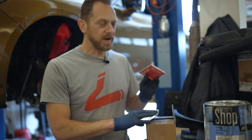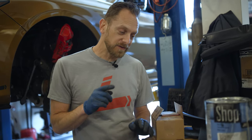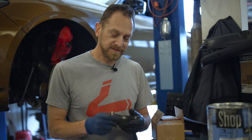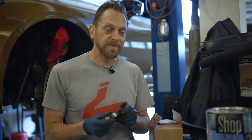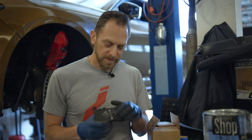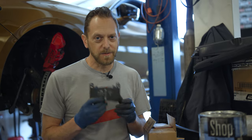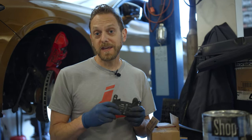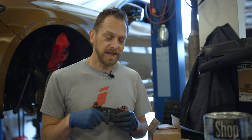Here is the part number for the factory Honda pads — I've got these for sale on heeltoeauto.com, link in the description. It's a Honda-specific compound. There's been a lot of press saying these pads absolutely are not track pads, and I can tell you they do stop fine on the track but they are not track pads in any great sense. At this time there are not very many aftermarket pad options available. I do have access to Carbotec pads in this backing plate. Hawk isn't making one yet, but I'm sure Hawk, EBC, they're all going to jump on this pad soon. This is going to be the same caliper as on an MDX Type S and probably future Type S models as well.